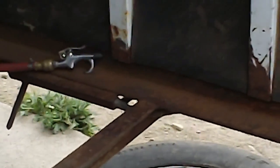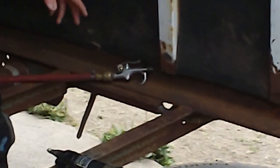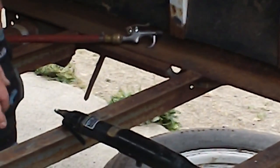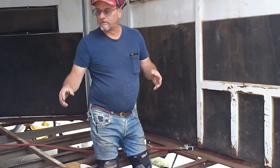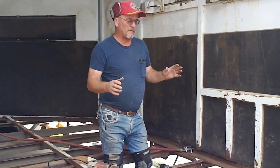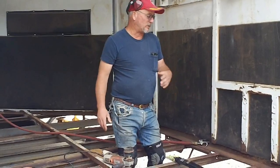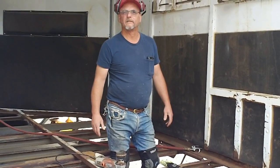You know what the original gauge of your steel was — you're going to want to grind these off. These Harbor Freight grinders are great because you can use them for wire brush or other devices. They come with a guard — you should really use those. You grind these off with a good grinding wheel, and we'll get to the rest of the fabrication or prep for priming the floors, for painting, so that all of this gets coated with a rust-inhibiting paint and primer. Prep is everything — that's what will determine how successful you are, how it turns out, and how long it lasts.